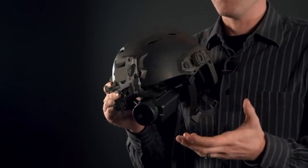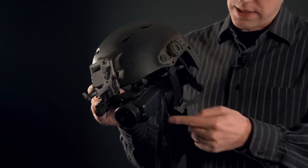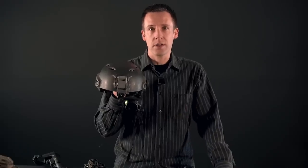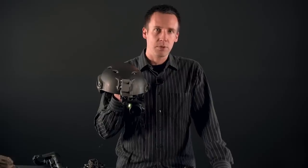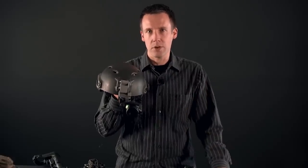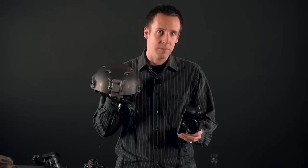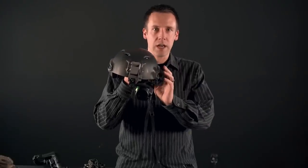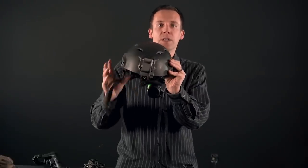What's more annoying is the image lag — the time it takes for light to enter the lens, get digitized, processed, and appear on the viewfinder. With image stabilization on, it's over 100 milliseconds; without, it's more like 50 to 60, which is pretty bad. VR researchers believe latency needs to be between 7 and 15 milliseconds to be really invisible to the user. The A7 viewfinder is about 15 milliseconds. At 60 milliseconds it's basically unnoticeable when hand-holding, but as soon as you strap it to your head and it becomes one of your eyes, it's pretty rough.